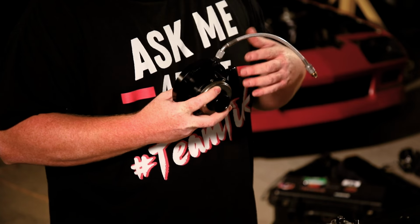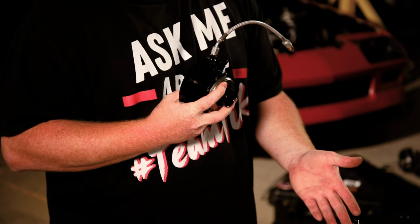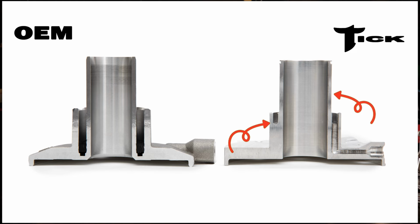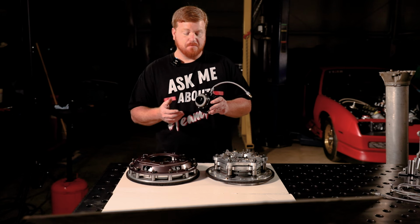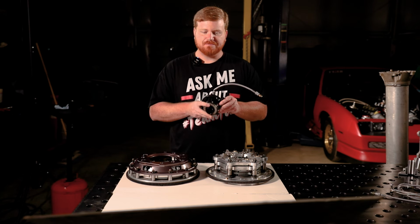It's just not going to be able to. With this system, it doesn't matter anymore, because now when you let go of the clutch, this moves completely away from it, and this does what it needs to do. With this new drag race release bearing after launch, now you know that your pressure plate is doing what you're adjusting it to, and you can have more consistent adjustments. So much like our other release bearing systems, this one has a double support system. It's double sealed. It does have a wiper seal to prevent dust from entering in. But again, the key component being that this is a retractable system.